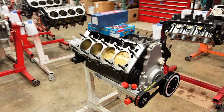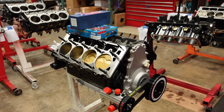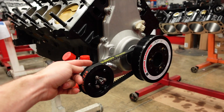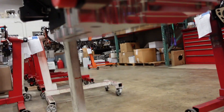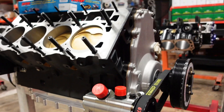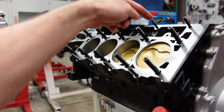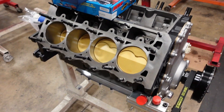Check this thing out everybody. This is an 1800 horsepower capable twin turbo standing mile LS 427 combination. Let's go through it. Dart SHP Pro Block, half inch head stud, billet steel splayed main caps with studs on the bottom. Billet daily three-stage dry sump system. Full billet oil pan, billet pump. We're running a billet center counterweighted crankshaft with billet I-beam rods and JE Forged Ultra 2618 pistons which have this sick gold thermal heat barrier.